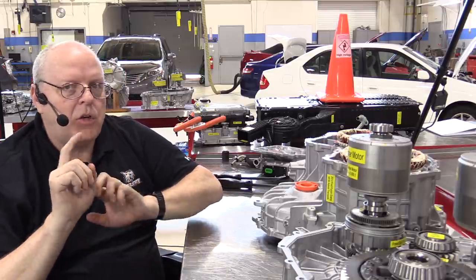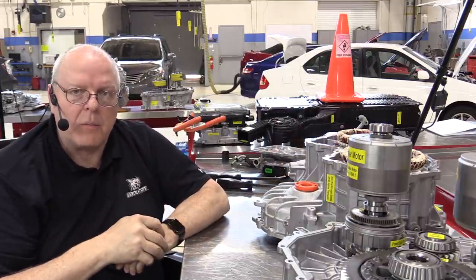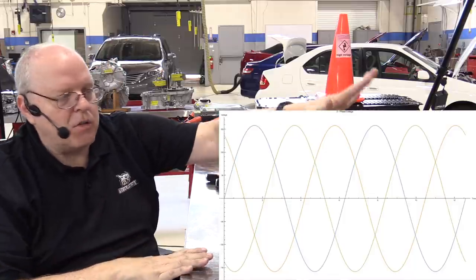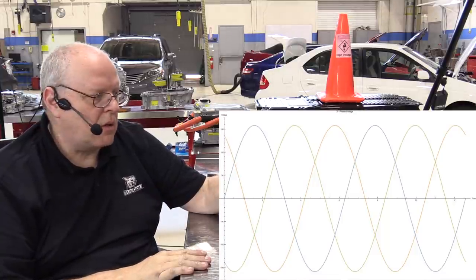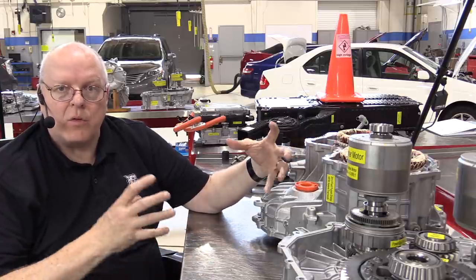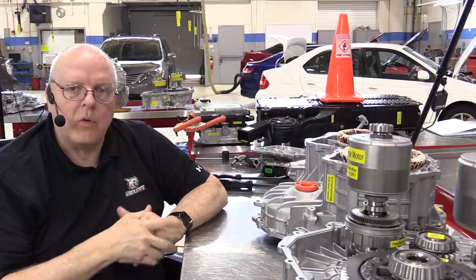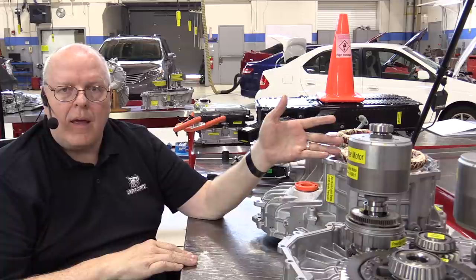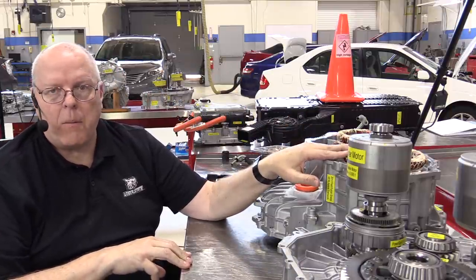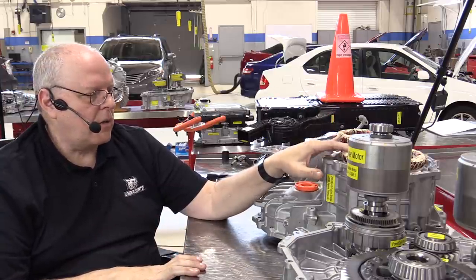Okay, as you decelerate with that regenerative braking, then that electrical current that's induced on those stator windings goes back to the inverter assembly, where it goes through a full wave diode rectifier bridge, where the AC voltage, the sine wave that is induced in these stator windings, is rectified to DC voltage, a bumpy DC voltage. And then inside the inverter, we have those 3 big smoothing capacitors in that one big black housing in the bottom of the inverter. Those smoothing capacitors smooth out all those bumps created during deceleration and feed current back to the battery through that big reactor coil of wire. And if the voltage was too high for the battery, then the reactor acts as a voltage drop and drops the voltage down to whatever battery voltage is necessary to charge the battery.